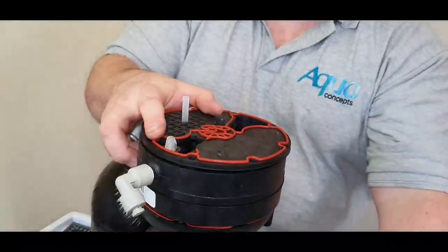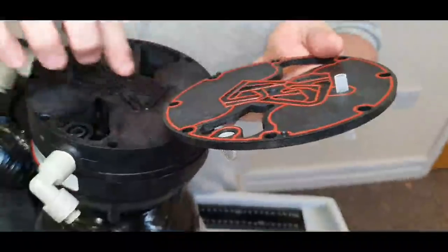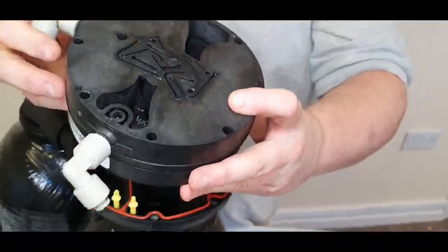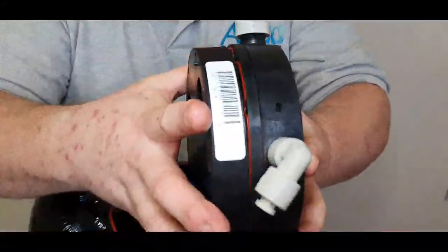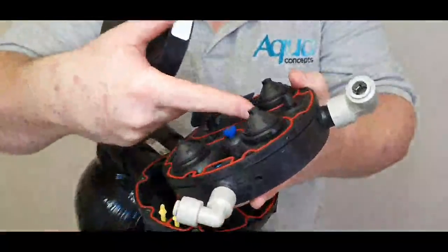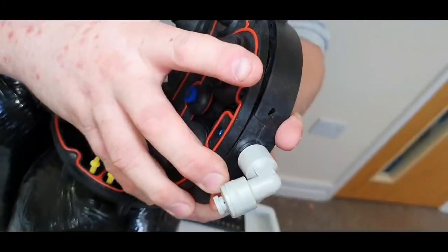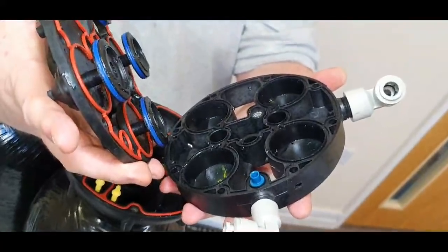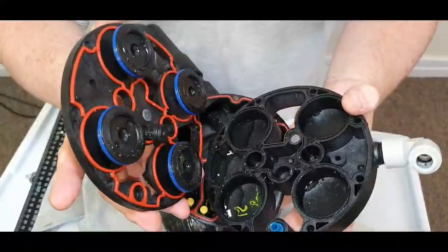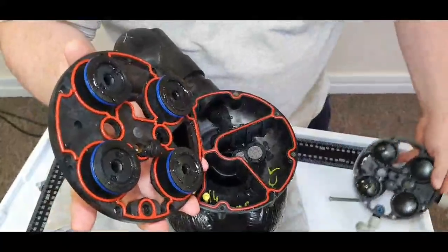Out comes the level one — that's the gasket between level one and level two. Taking the level two off, it's already got a gasket inside and that covers a little pattern of channels. The next sections three, four and five come off together, and if you slowly pull them apart you'll see the control valves which seat inside level four with a little rocker. Pulling three and four apart you can see the quad seals and the control valves. Each section of the regeneration cycle has these valves in a different position — I'll put the different configurations in the link below.